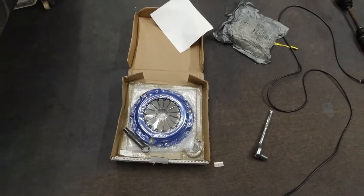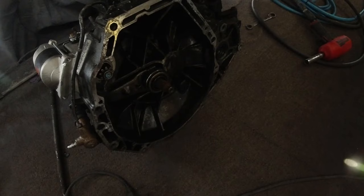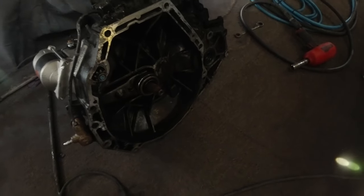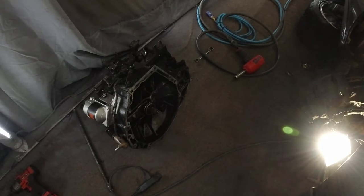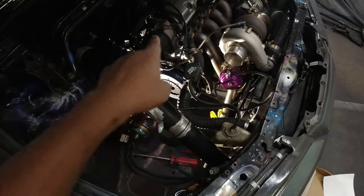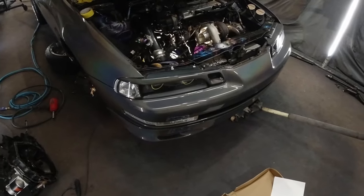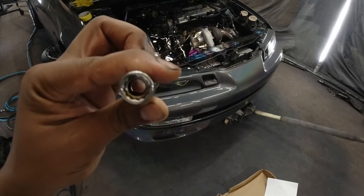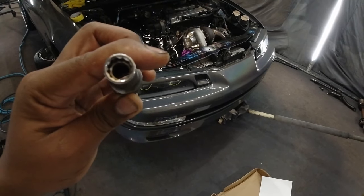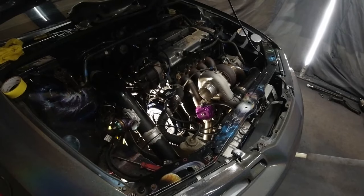Now that the transmission is off, I'm upgrading to a Stage 5 clutch. The actual clutch is still good — it hooks full power — but my throwout bearing was going out, rattling real bad. No point doing all this just to change the throwout bearing alone, so I'm doing the whole clutch. This Amazon clutch has been putting in work. The clutch has five or six 10-millimeter 12-spline screws, and you'll need a special 12-spline socket attachment. If you're replacing the flywheel too, you'll also need a 17-millimeter.